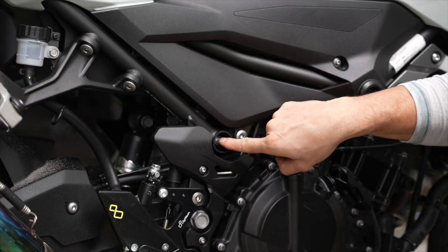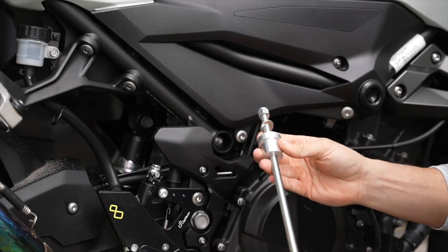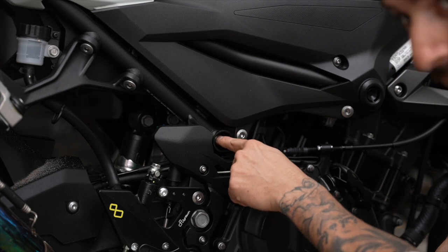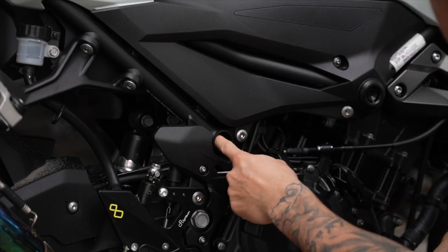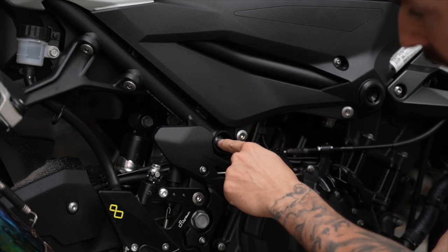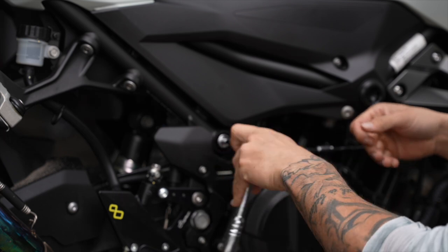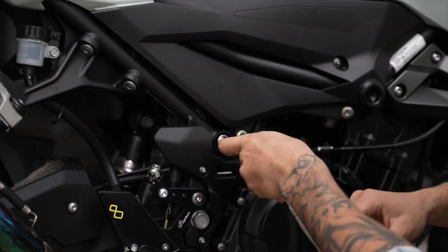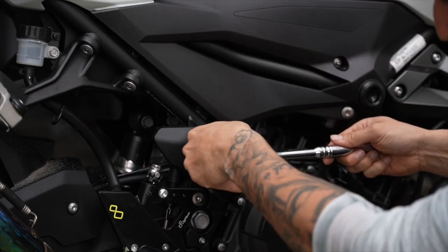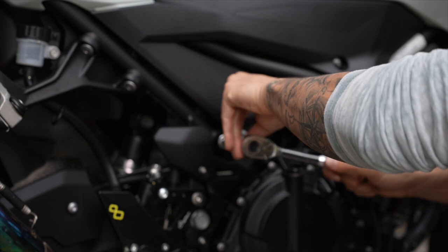Right smack dab in the center of the bike, we have this bolt — that's where the all-thread is going to be going through, right in here. I already broke the torque here, but there is a 14 mil on this side — a little hex bolt — and then there's a 14 on the other side. On the other side, you can't see the threads; it's just a bolt. But on this side you can see the threads, and it's a bolt. I'm gonna see how far I can loosen this. You don't have to hold it on the other side — I've seen videos showing that you have to hold those threads on the other side, but as it turns out for this one, this is a 14 mil and it doesn't seem like you have to.